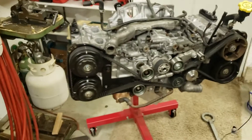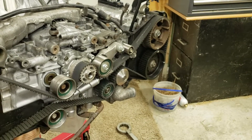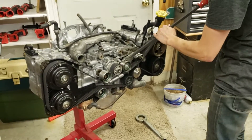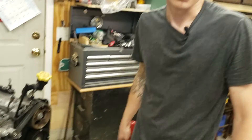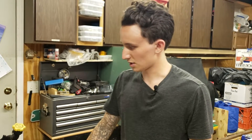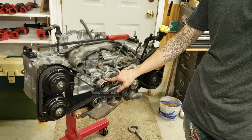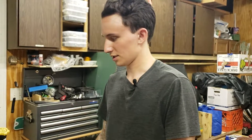So if you're confident with your timing job, now's the time when you can pull the tensioner pin. Pull that out. Then just give your tensioner a little push — it just helps it tension the belt. You don't have to go crazy with the pry bar. You'll feel it; if it stops moving, you're done. Don't go crazy on it or you might damage something. But that's how you time it. Now you just have to set your belt guides. I think the clearance is one millimeter. So if you've got feeler gauges, or if you happen to have a one millimeter hex key, you can stick one in there. Anything that's like a millimeter — it doesn't have to be exact. Don't make it too loose where the belt can skip a tooth. But that's it.